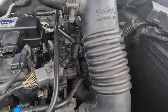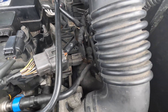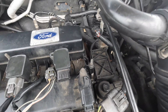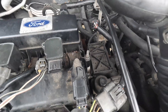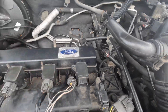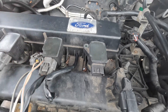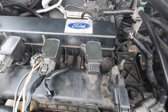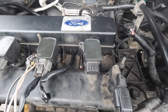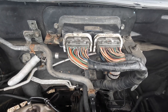When I pulled this one off — instant out. And now you can hear the engine is alive; there are sounds coming from the engine which weren't there before. So that was it — it's somewhere here. The next check was to disconnect this completely and then see if replacing the fuse would blow, and whether the engine would start, because I was worried it might actually have been the ECU.